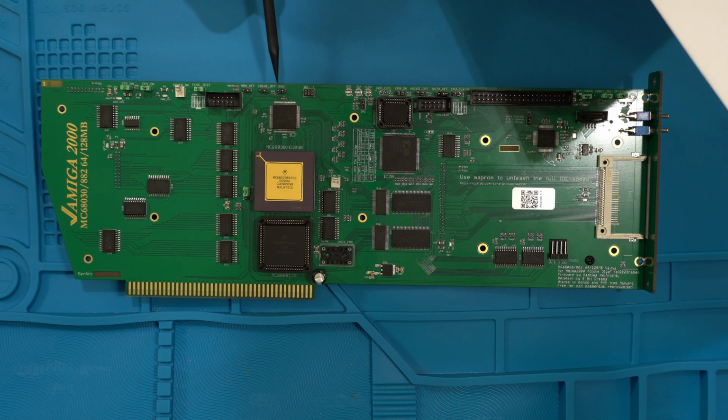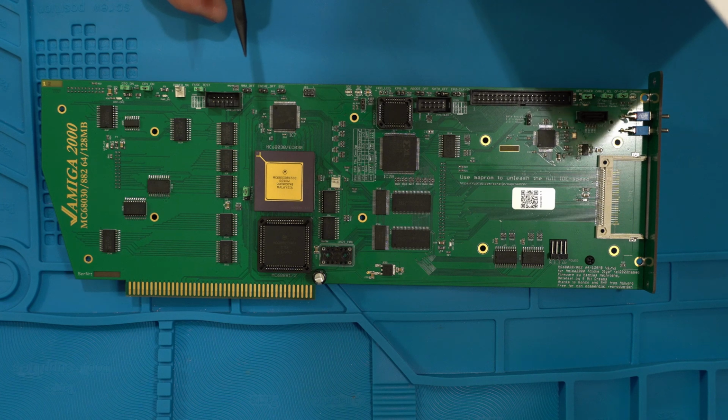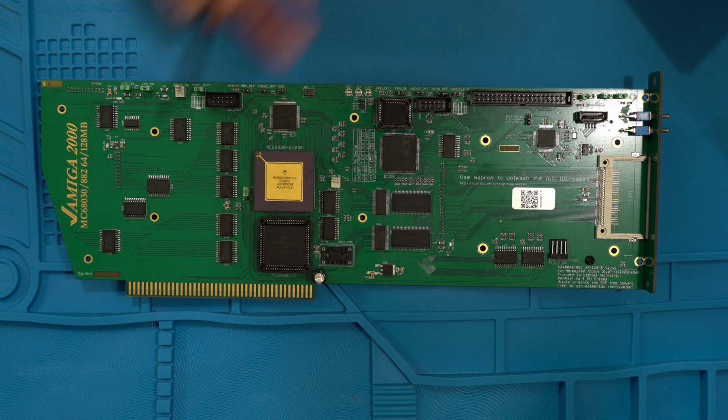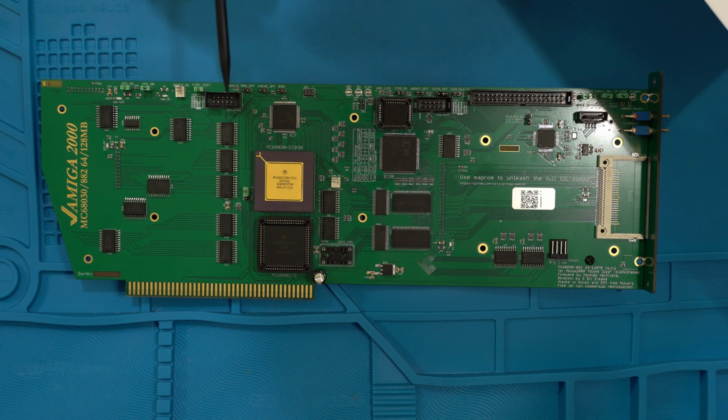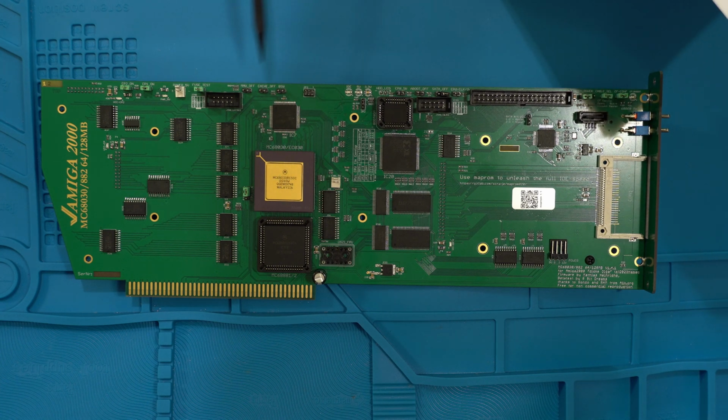So you'd have to put a jumper on here and take the 68000 out of the slot. Of course, when you do that, you're going to lose the disable functionality of the CPU. So basically the CPU disable is the fallback mode. You won't be able to use it on the revision A of the Amiga 2000, the Amiga 2000A models. Yes, that went well.